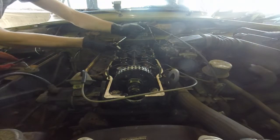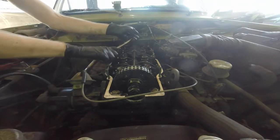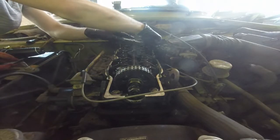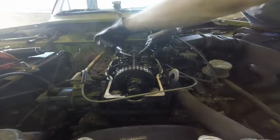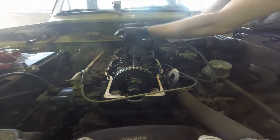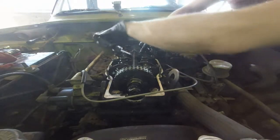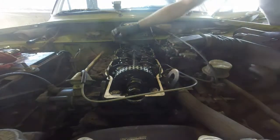But you also don't want it too tight. If you get it too tight when the engine gets to full operating temperature — and every now and then it will run a little too hot — it won't seat properly, and that's bad; it will really break the engine. Now I'm just going around double-checking and locking down everything. Cylinder 4 needed a slight readjustment. Take the time to do it while you've got it all apart — there's no points in winning this race, but if you screw up an old engine it's hard to replace.